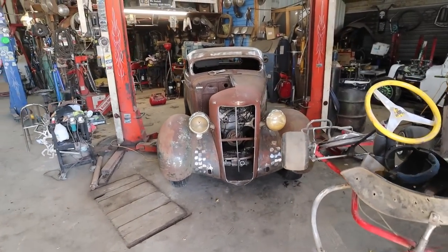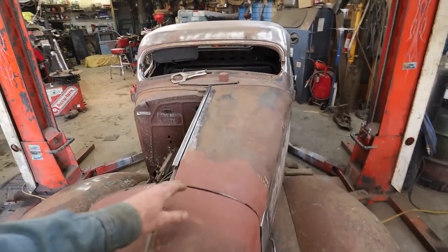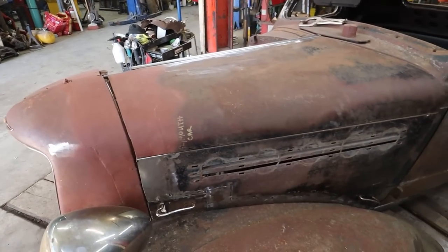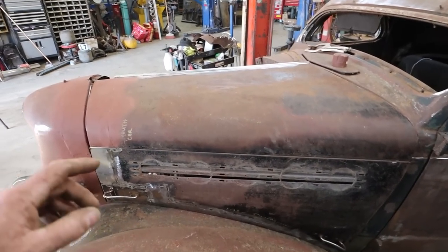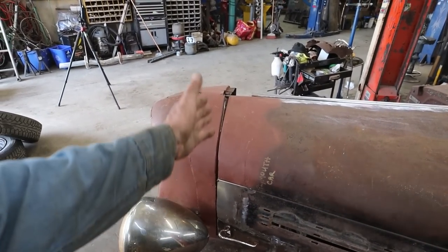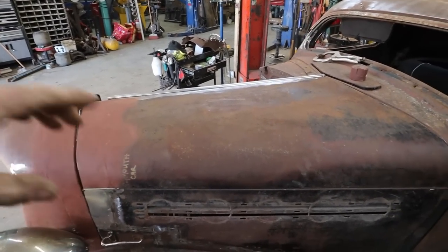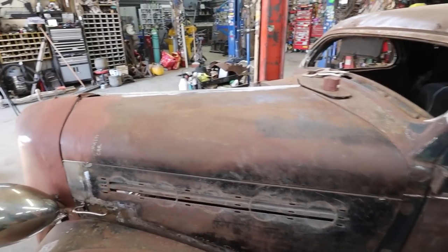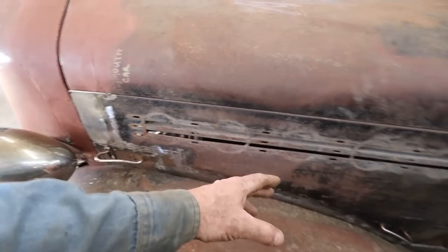But anyways, our plan for this one: I have the other hood just about done. Then I think what I'd like to do is take it out, sandblast it, and we still have to work it to the grill a bit. I want to sandblast it, get it either in an epoxy or something, get it one color, maybe do some really light bodywork on it. I don't think I'm winning by not doing any bodywork, so we'll have to address a few of the spots.